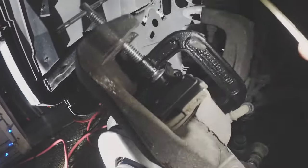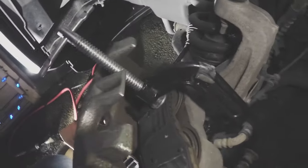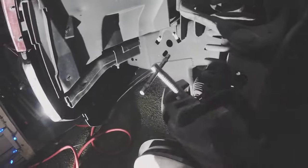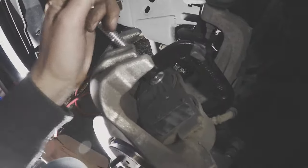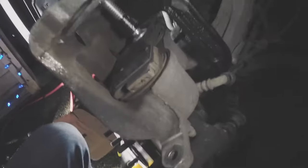After you've done everything — put all your pads in, your rotors, your caliper carrier — double check your bolts, always. When you come up to the caliper, you'll notice the caliper pistons will be a lot higher and they won't clear your new pads. So what you've got to do is use a C-clamp like this and compress the pistons back in. Some people have a special tool, but you can use your brake pad — just rotate and the pistons will go down.